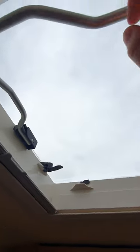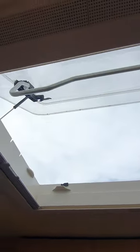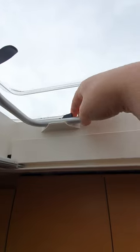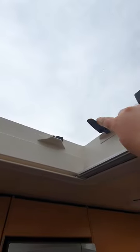With your big roof light in the front here, these are what they call a Heki 2. When you want to open your Heki, you want to press the button in before you rotate that stay. If you just pull the stay without pushing the button in, it will break. So make sure you push that in and rotate it round. You then pull the lever down towards you and push the roof light up. You can click the handle back and leave it fully open, or you can pull it down a little bit and just sit it on those little pieces and clip it in, just so it doesn't fly up on you — so you can just leave it cracked a little bit to let some fresh air in. To close it, release that, push it back up, pull it down, rotate the handle round, and then you can just slide these round. You don't have to push the button when you're going to close them.